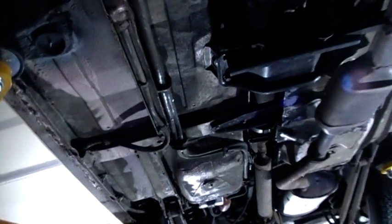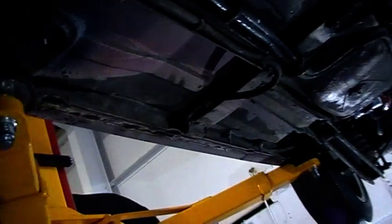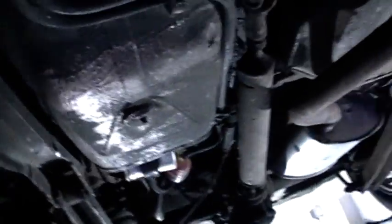We've injected the S50 into the cavities, into the main legs, and also injected inside. Credit to Alfa — they've actually done very well at putting little injection holes in places like the sills and all the chassis runners, to make sure you can get wax in there, which may well be why it's lasted so well.